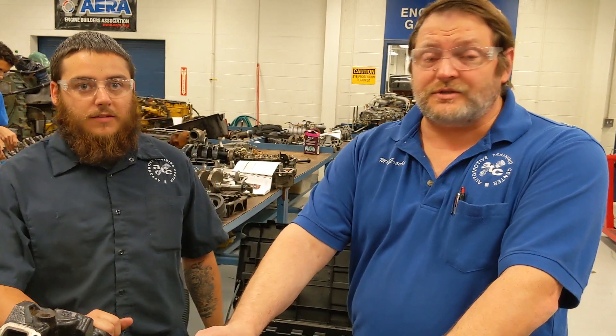He's come up with measuring that this piston has thirty thousandths of clearance, so this piston is a little worn out. It should have only around three thousandths of clearance. So these are some of the things that you have to do to make sure that an engine successfully lives when you put it back together.